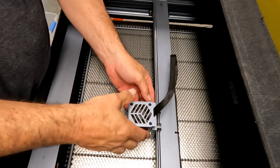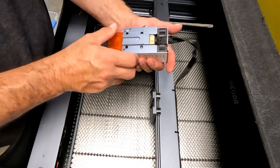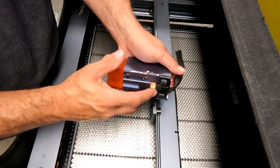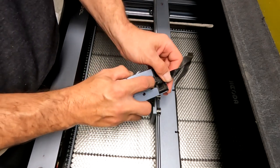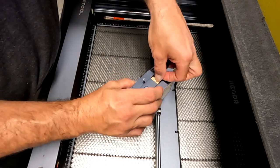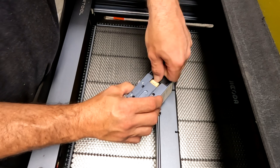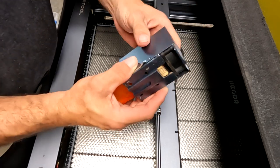The first thing we need to do is remove the laser. Loosen your adjustment screw on the left side and just pull straight up on the laser — it should come out. There's a little clip right there. You've got to take your finger, push down on the clip, and that'll release the wiring harness. Pull up gently. Try to use the harness as much as you can — you don't want to pull on the wires. I've got my thumbnail in the top of that harness, so I'm pulling up with the plastic, not with the wiring.